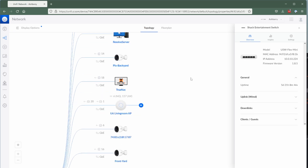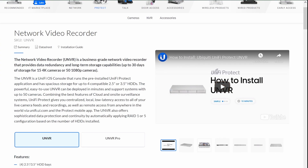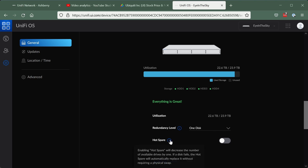This was a dream for cable management and let me put the devices exactly where I wanted to. Finally, in the stack, we have a UNVR, which has four 8-terabyte drives in it and records 30-plus days of 24/7 4K media from my security cameras. The drives are NAS-rated spinning drives striped in RAID 5, while the configuration helps with the speed hit of the platters. I wish they were SSDs. Frankly, if I were smart, I probably would have put one SSD in the UDM Pro and called it a day.